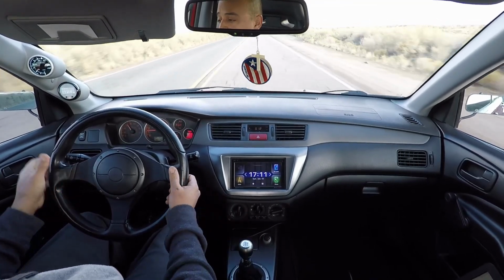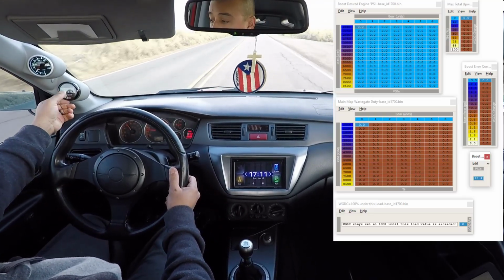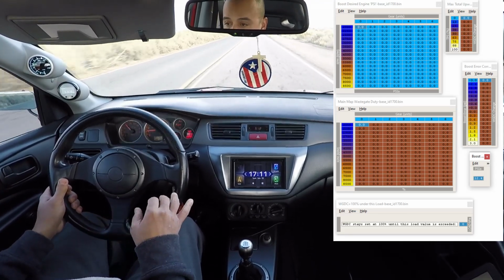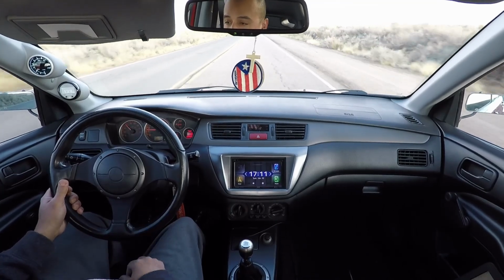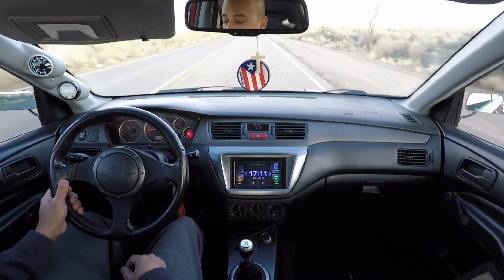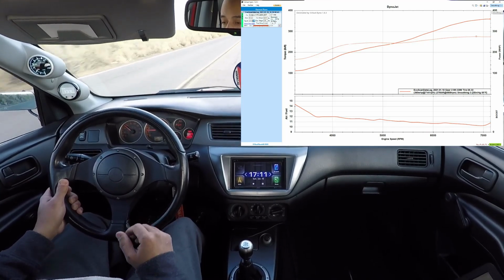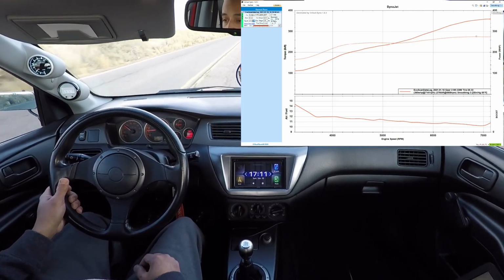All right, and that was it. And here's the log, or the 13.9 psi is what we were able to do with just wastegates, and that's with the 2 black springs installed, one on each of the wastegates themselves. So I'm using a virtual dyno as a reference point. By no means am I relying on these numbers.